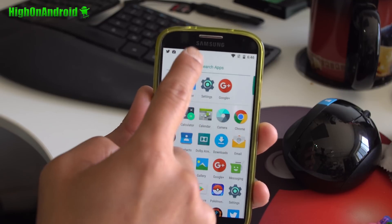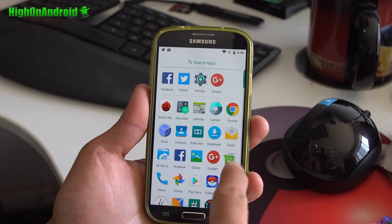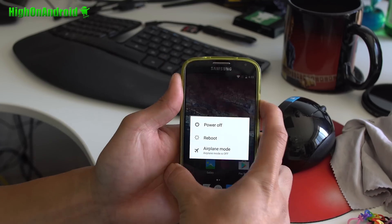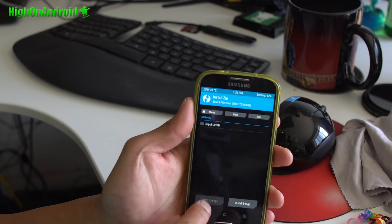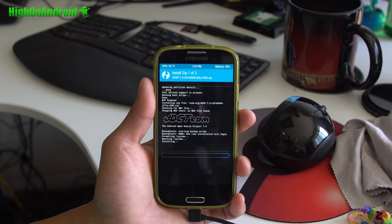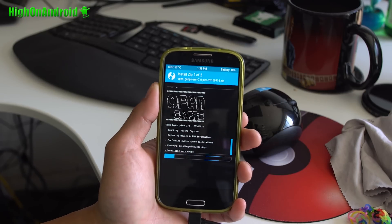Overall, this is an excellent way to upgrade your Galaxy S4, so if you have a supported Galaxy S4, give it a test drive this weekend and do let us know what you think. Installation is easy: reboot into recovery, make a backup ROM if you want, do a factory reset, install the ROM, add GApps, install it, and reboot — and you should be on your way.